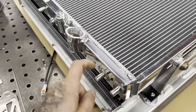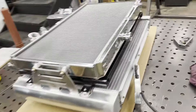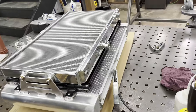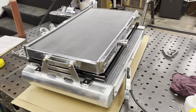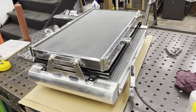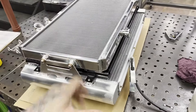I'm going to pull the heat exchanger and AC condenser out to weld the bungs and brackets properly. I'll cut off the tabs meant to mount in Hondas and also cut the rad cap off — we don't need a rad-style pressure cap on this system. I'm undecided on whether to put an O-ring type cap in and extend it up into the grille area, but I probably will since it's going to be a huge cooling system with the tank in the back of the truck.